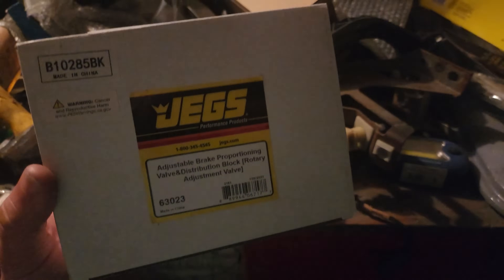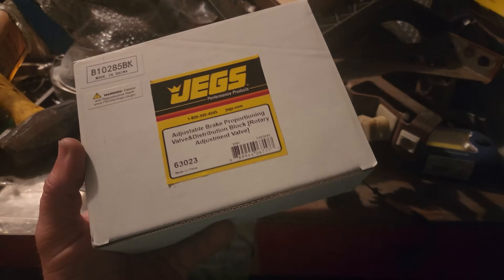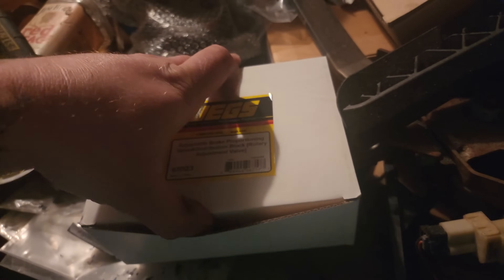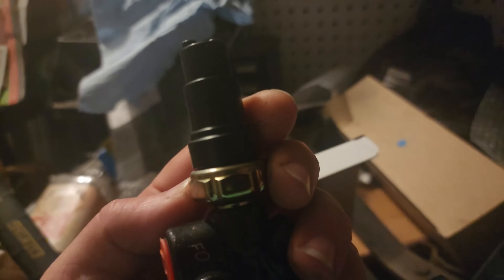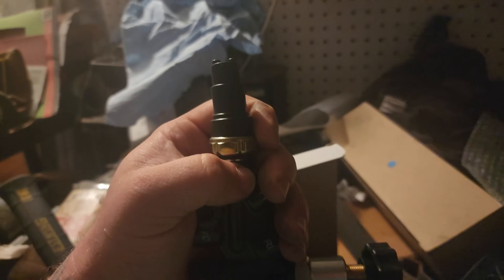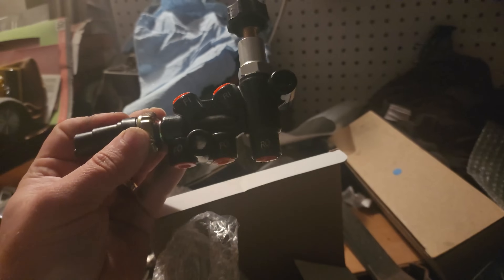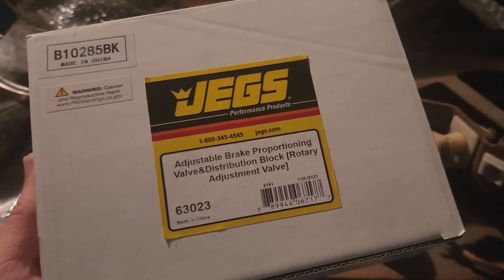For race applications, most of you are going to have manual brakes — a manual brake master cylinder with no brake booster. Most of these kits come with a mechanical switch that operates on pressure. Once the pressure pushes it enough, it closes the switch, which sends whatever you're feeding it through. If you're feeding it a positive wire, it's open all the time. When it gets pressure — meaning you're pressing the brake pedal — it closes the circuit and sends that positive 12 volts through the sensor. That 12-volt positive feeds to one of your relay trigger wires, which feeds to accessory out to your brake lights.